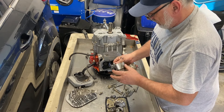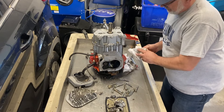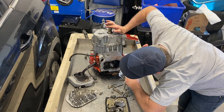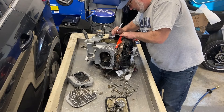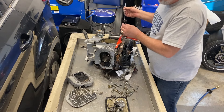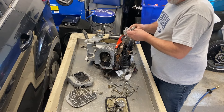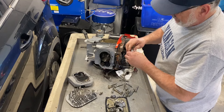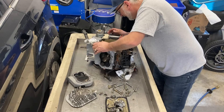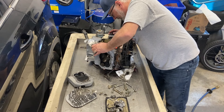This piston's got a little worse scoring. Again, the skirt is broken off. The actual cylinders are really good though. And that is a snapped lifter — a cam follower that actually snapped. How the heck did that happen? There are pieces of crap everywhere in here.